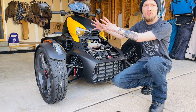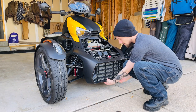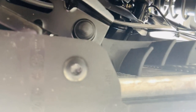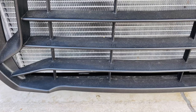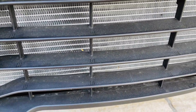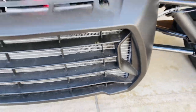Now that we've got the hood off, place it in a safe spot so it doesn't get scratched. We're going to remove two bolts underneath the fender using the T30 Torx. They're located right here — I'll show you underneath. There's one right there, and the other one is right there. The bolt is a little bit further back, in between these two posts. Same for the other side — right back here in between those. We're going to go ahead and remove the fender.